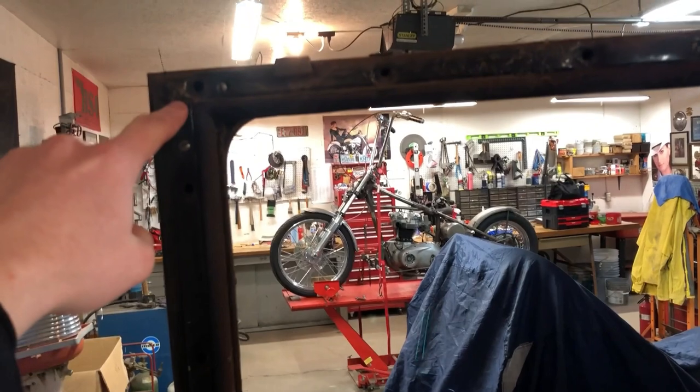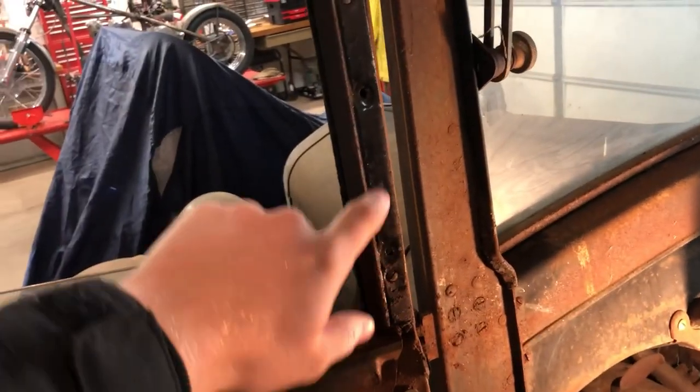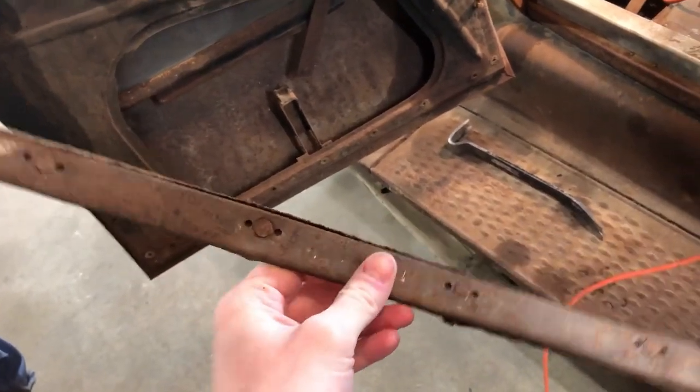On the other side the glass is still there. I figured out how to get this glass out — you have to take off these trim pieces at the top and on the side, then take off this trim piece for the window sills and you should be able to pull the window out. Here they are laying on the floor; they have little staples that held them in.